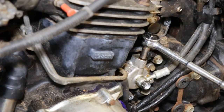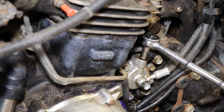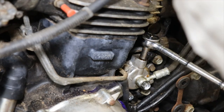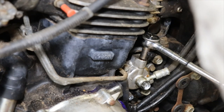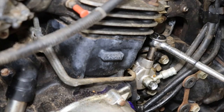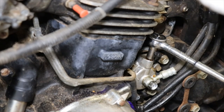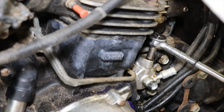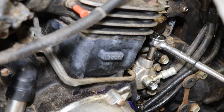So all that stuff that was in the brake line, pushing it, pumping back through there. Put some more fresh in it. I did feel some pressure, so that means that either the slave cylinder is pushing or the master cylinder's about bled up, but like I said, we'll have to crank it up and put it in gear and see if the clutch is free on it.